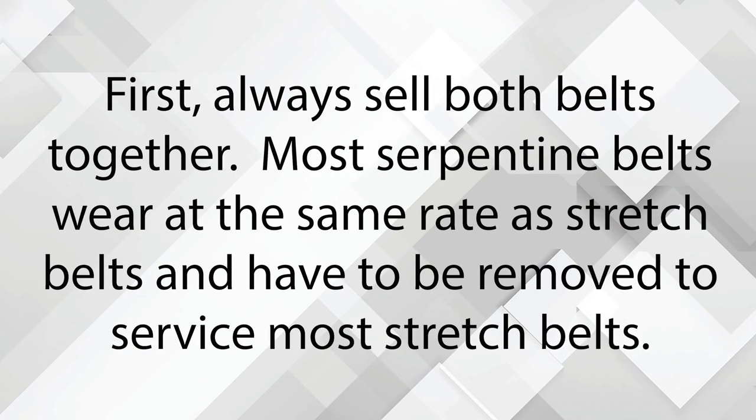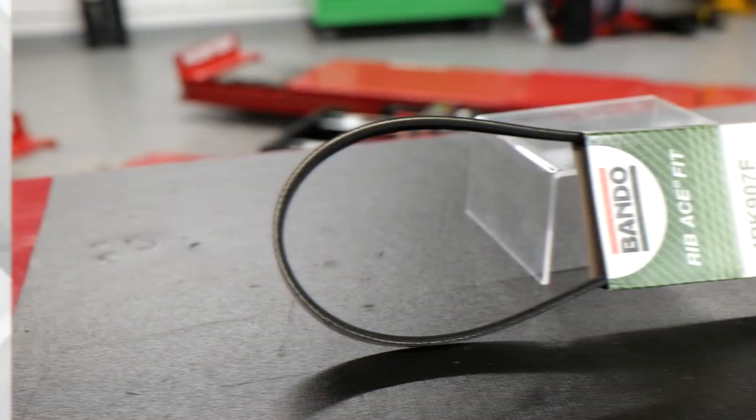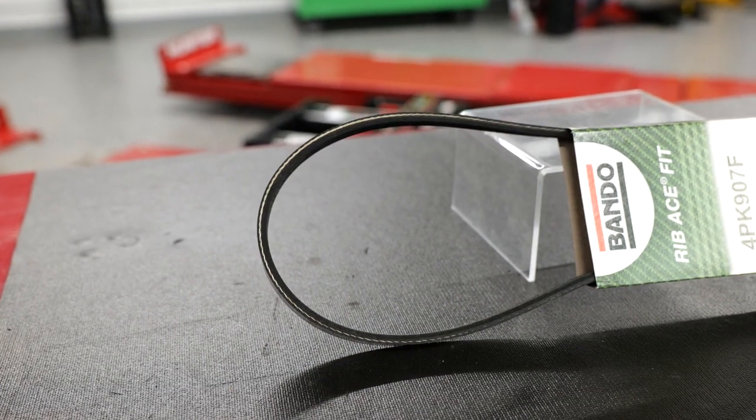A few quick selling tips. First, always sell both belts together. Most serpentine belts wear at the same rate as stretch belts and have to be removed to service most stretch belts. And when you're selling a stretch belt, be sure to recommend a high-quality belt such as this Rib Ace